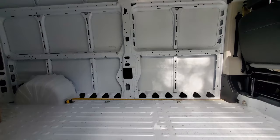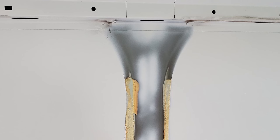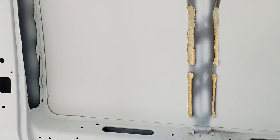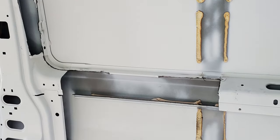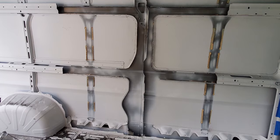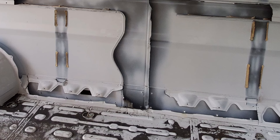Taking a look at the inside of the van, the location of the slide-out is measured out — I have it highlighted in red in this video. Most of the support structure inside this area will need to be removed. Some of the bridging structures can be removed by cutting two tabs at each end. I used a Dremel with a cutoff wheel for this purpose, then progressively worked with an angle grinder with a cutoff wheel. I want to ensure that I am left with no more than ¾ inch of material protruding from most of the van skin. It is important to leave the triangular shaped structures at the bottom — they are used to fasten to the slide-out platform.